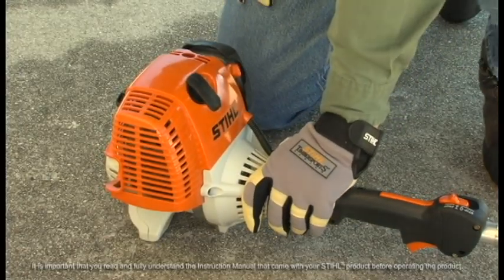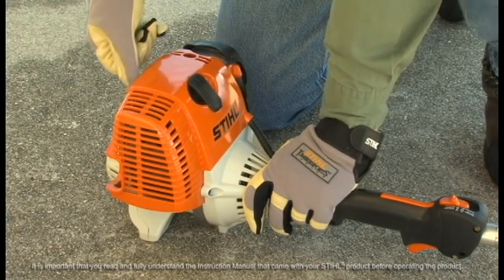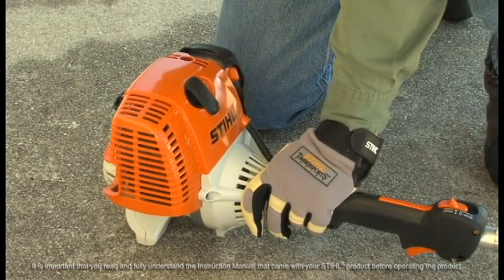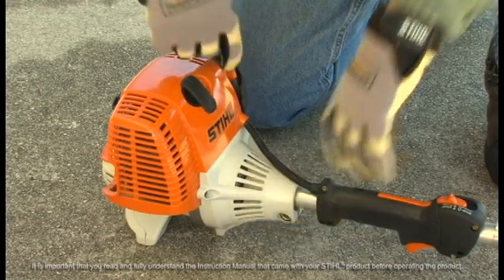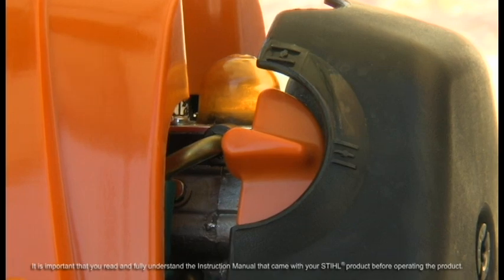In the proper position and with a sturdy grip, pull on the starter rope until you feel it engage. Then give it a brisk, strong pull. Do this until either the engine tries to fire within five pulls, or if you have attempted five pulls and the engine does not try to fire. In either case, do not pull on the rope more than five times. At this point, move the choke to the open or run position. If you don't, you may very well flood the engine.